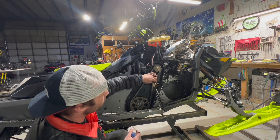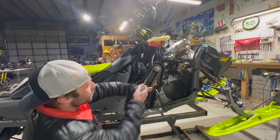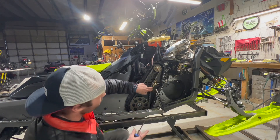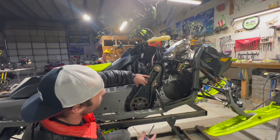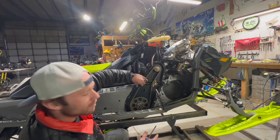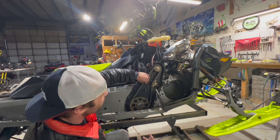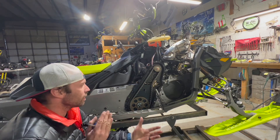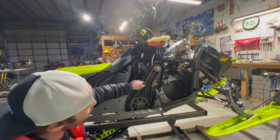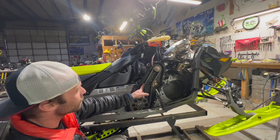The tensioner has this poly glide and it's putting pressure on the chain — that keeps it in tension, keeps it tight around the bottom of the sprocket making the most contact it can. That's maybe three and a half turns and it's really loose. If the sled's loading really hard and unloading, that's putting a lot of force on the chain which is unnecessary. That's why it's so important to keep it tight.